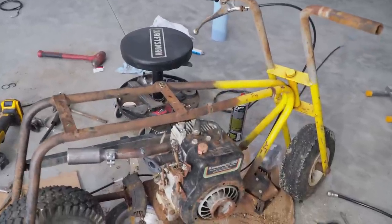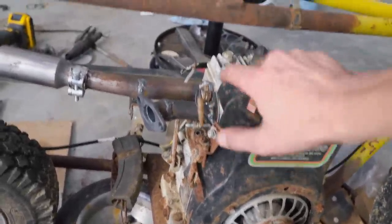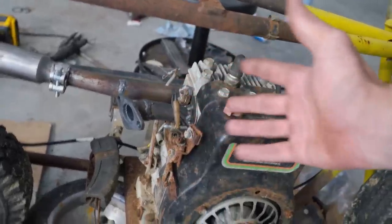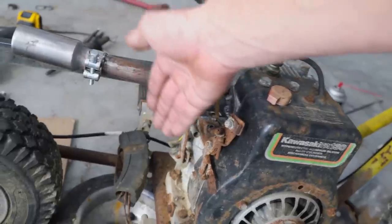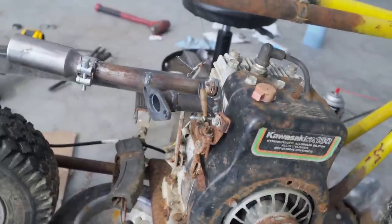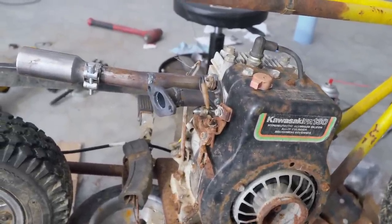All right, so I'm going to fill you guys in a little bit. I've been working. I've got the intake welded up, mocked up. Got some spacers, because we didn't feel like removing the studs, because it'll be fine, right? Got this welded. I cocked it this way, and got the carburetor away from the hot exhaust pipe. I'm going to bolt this thing up, and hopefully Ike will be back in here to hold the camera, because I am definitely not a cameraman.